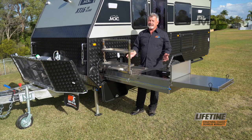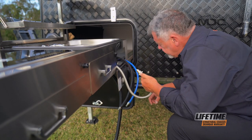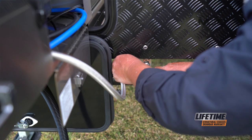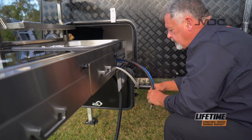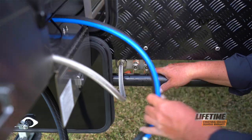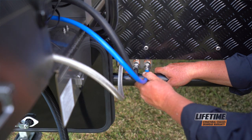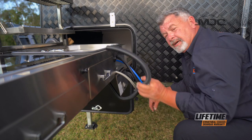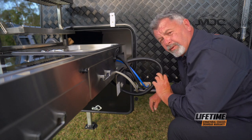Now we need to connect up the water and the gas. Grab your gas bayonet first — there are notches on the side, you'll see where they line up on the little female receiver inside. Plug it in, push and twist and your gas is connected. The conduit coated hose, or the one with the red interior, is the hot water — that goes into the fitting on the left. Push it in and it snaps closed. Now connect the cold water. Don't forget to get your kitchen drain hose out and run it into a bucket or somewhere away from the camper if you're allowed to drop water on the ground.